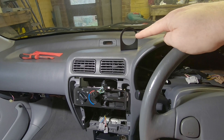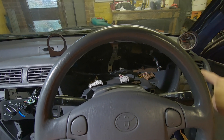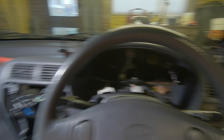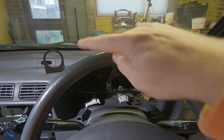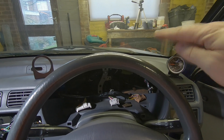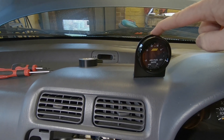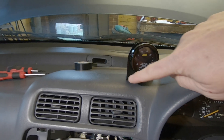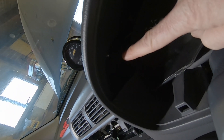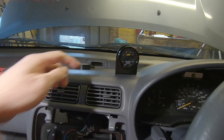I'm going to mount the AFR gauge here — I like all the gauges to be at the same height if possible. Ideally we could put them in the vents, but that's a bit low for me. As low as we can go on the dash, and thankfully when looking at it they're not obscuring the field of vision — they're low enough that the top of the dash and the bonnet are above them so I'm not blocking any of my view. I've mounted the gauge using the 2mm thick aluminium bracket I made, with a little bit of double-sided foam tape underneath and two M6 bolts through the dash — plenty of room, no wiring underneath this section.